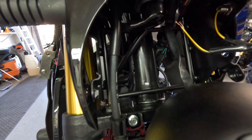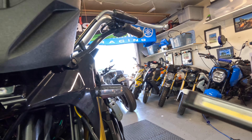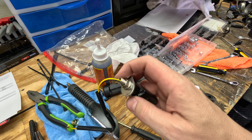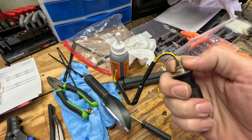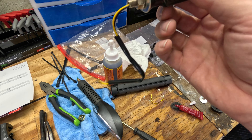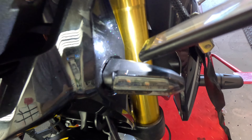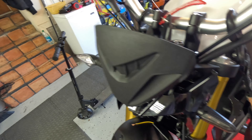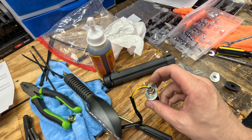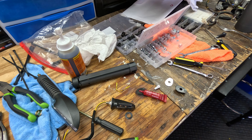These will get spliced in fairly simply. For mounting, what I found best was removing the metal plate off of there — it allows you to remove the plastic piece as well, and that lets them sit a little more flush and a little deeper. I like the way it looks. Since you're removing the metal backplate, I'm choosing to use some washers on the back for a little more support, since these things are going to be vibrating and you don't want stuff to come loose.